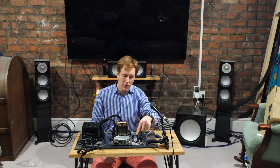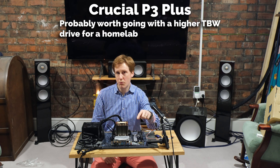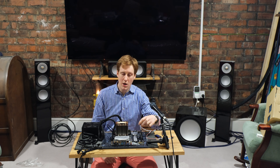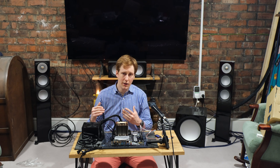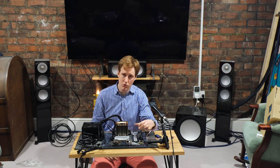On top of that I've simply got an M.2 in here. I chose to go for the Crucial P3 Plus instead of the MX500, and I've ordered a second one to go in the second NVMe slot so I can mirror the boot drive and get a bit of extra redundancy. If you want to keep costs down and you're at home, just make sure you're running plenty of backups of your config so you can fresh install if disaster happens. Since this is going out in the field I want the mirrored drives for breathing room.